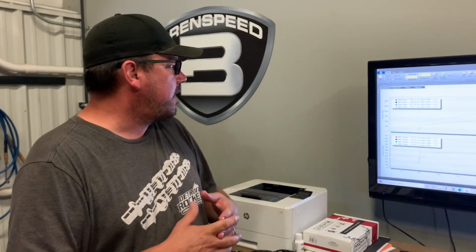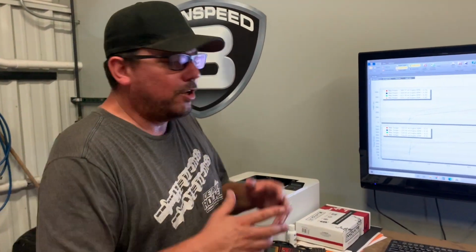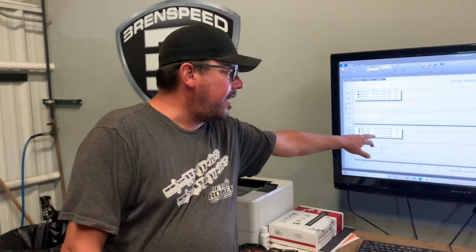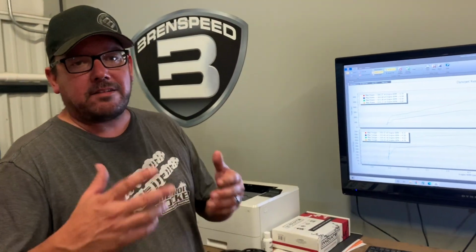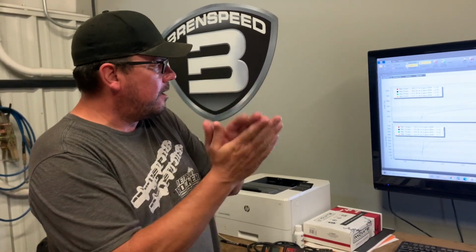So really, to me, it's basically the same. We came in with the airbox lid on, 615 at the tires, 619 with it off. You can get that difference on two dyno pulls anyways without taking that off. And then torque came in 529 with the lid on, 516 with it off. I don't think taking the lid off really makes a torque loss. I just think two pulls like that overlaying, it's not gonna be the same every time. It never works that way.